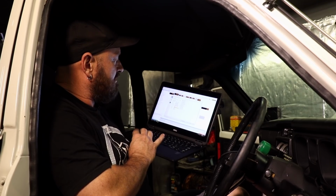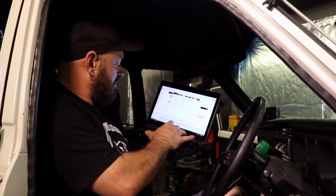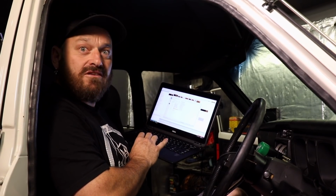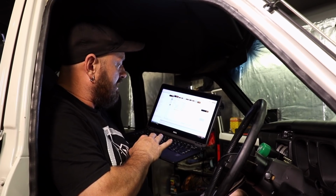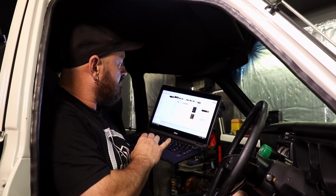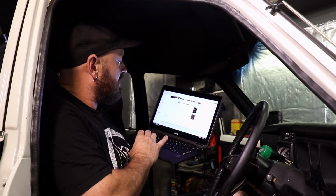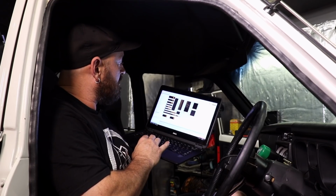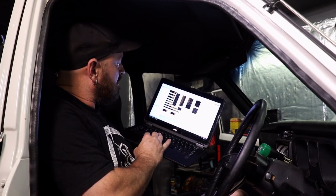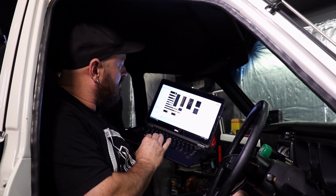Timmy says 0 is easier to see. It doesn't really matter where you got it as long as it's easy to see on the actual crank pulley. So we'll set that up. We'll go OK. Then we can go into diagnostics and see if our crank sensor's picking it up. So we've got trigger synchronization state, synchronization level, and errors.